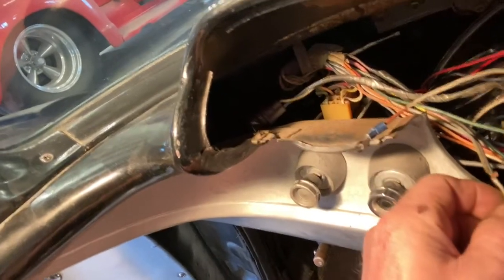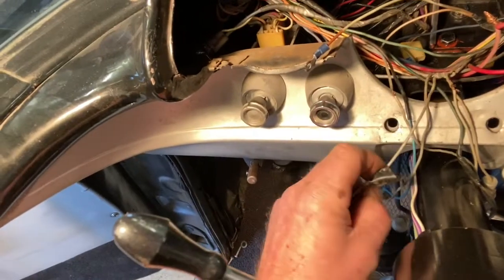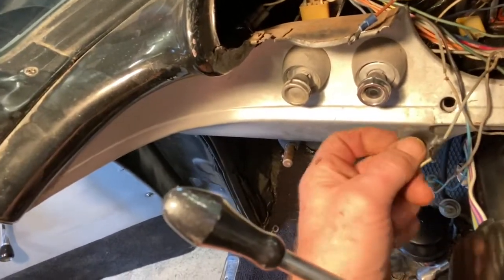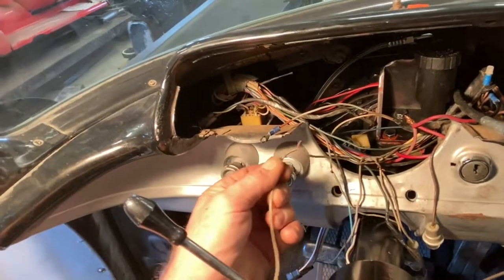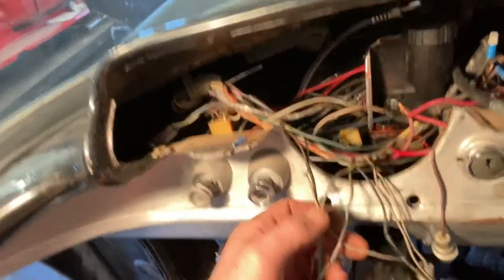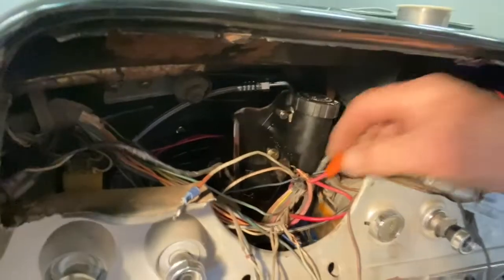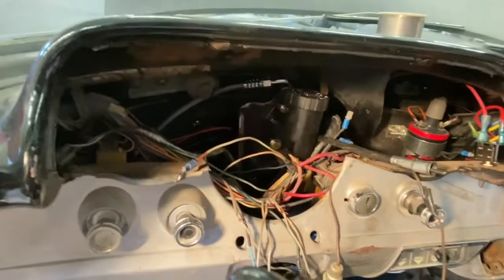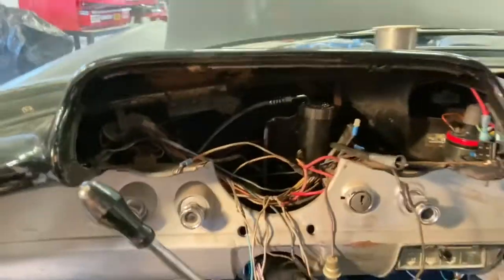We found some stuff here you've already seen — just wanted to show what not to do. This is a fire hazard just waiting to happen with all the vibration and dry rot on the tape. We don't recommend wiring like this because that tape's going to fall off. You're going to put your dash lights on and get shorts going somewhere, then you'll be driving down the road wondering why there's extra lighting behind your dash cluster. So we're going to take that all apart and solder it properly — taking the household wiring situation out of the build.